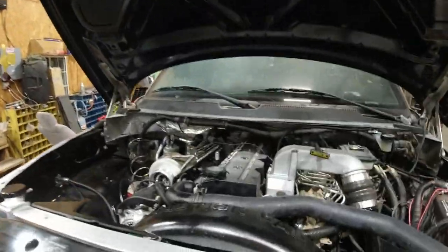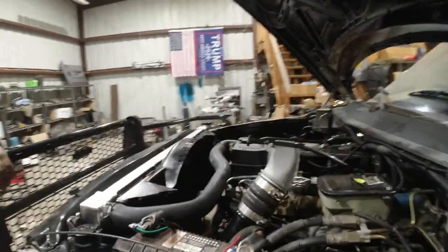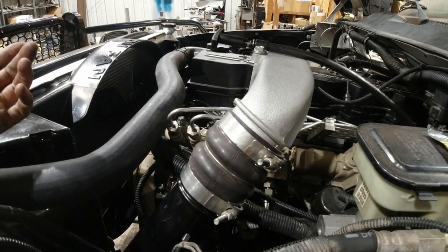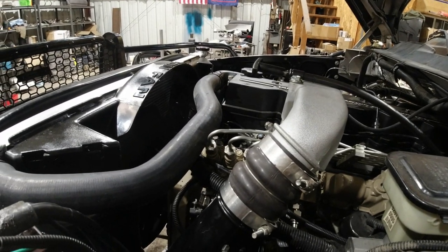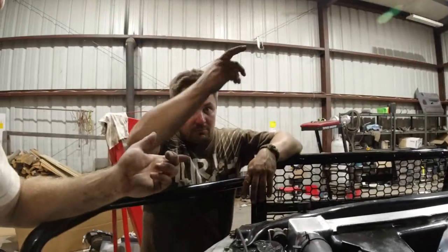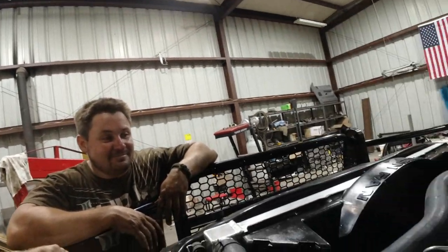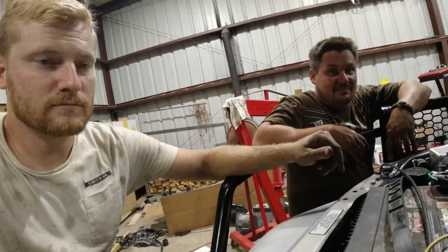I'm just glad this thing sounded healthy again. There were a couple of things we also changed. It was having a problem where if you ran it and tried to fire it the next day, it cranked like it lost prime. The FAST is fine, the check ball in that is fine. But the check ball for the return on the pump — which holds pressure going out of the pump — I tried to mess with it to get different pressure and I think I scored the check ball. Tommy had trouble with his truck, so he robbed the return check ball off grandma's engine, which fixed his problem enough that he drove straight into an oak tree. So I robbed it back off Tommy's, and now we've got 55 PSI — better than not having a return spring ball.